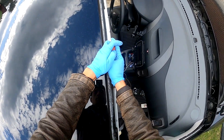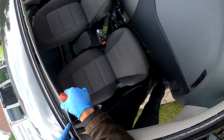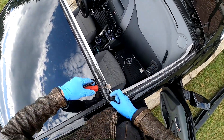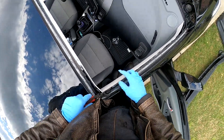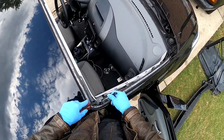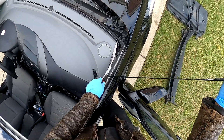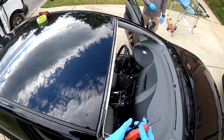Take your time scraping — scrape toward the edge little by little and it will loosen. Control your blade carefully, because one loose grip and the blade can fly into your customer's car and you'll end up owing for a brand new paint job. On this one I did forget to move the A-pillar cover, so I went back and moved it out of the way — it only takes a second. Moving it makes it a lot easier when shooting the new urethane, and the scraping process is easier too with none of that plastic in the way.